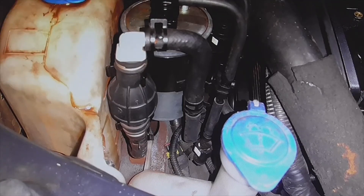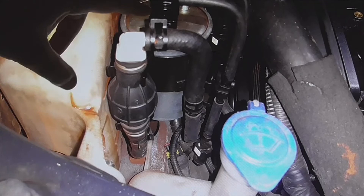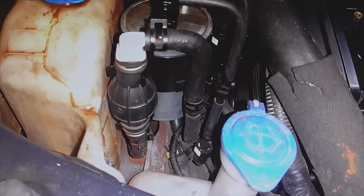There are people who install it on other vehicles. As I said, in this one it comes standard, to fill the diesel filter. There are also people who have problems where air enters the injection pump because it has bad seals.